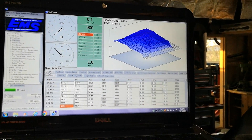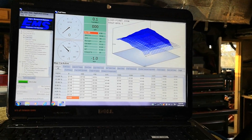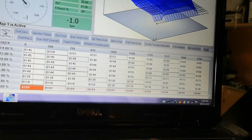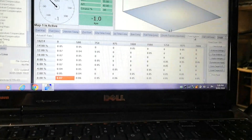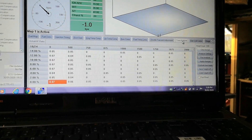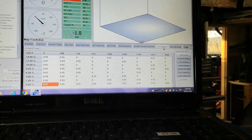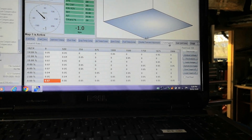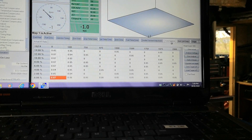This is my base fuel map that came with the car and the ECU — basically a fuel map to start and run. I've been fiddling with the tune analyzer and from my readings it looks reasonably rich. This is set in lambda, so a value of one is equivalent to a 14.7 air fuel ratio, and the readings are well under one at the moment, so I think it's running quite rich.